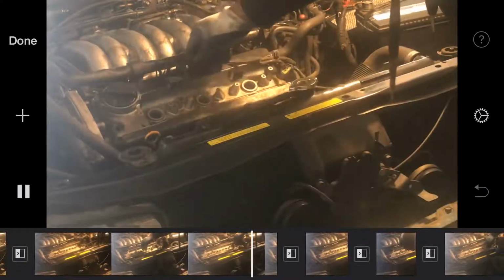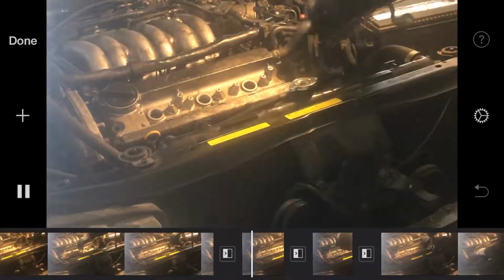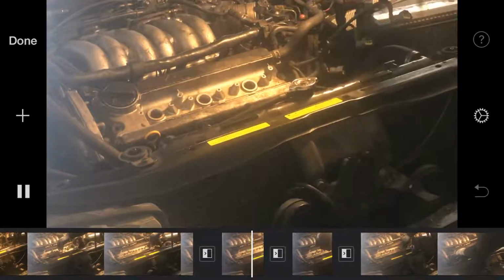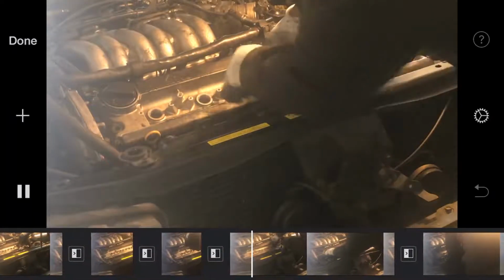The parts that go into the coil. This hose right here goes right here. So when you see that hose, it goes to here. Once you take your coils out and you took off these parts, start unscrewing the screws on the valve cover, and these are 10 millimeters.